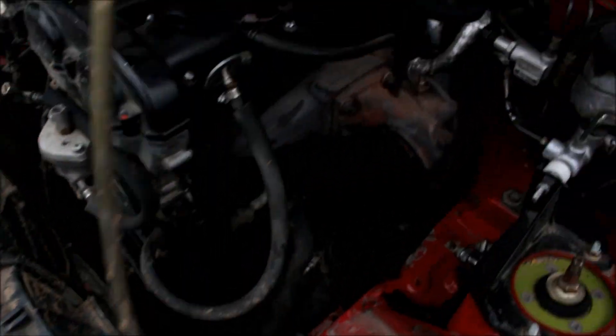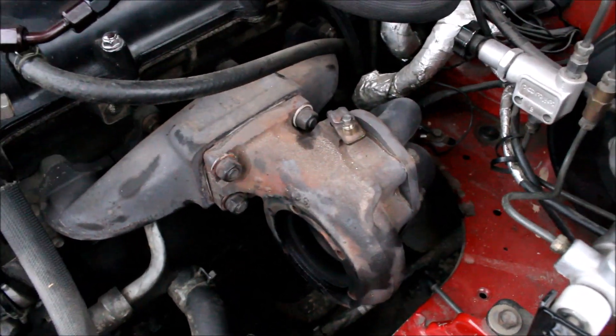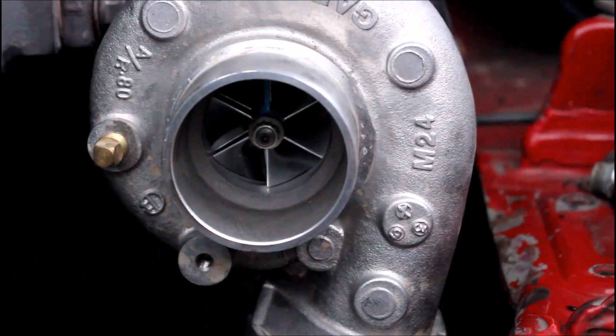Now I'm going to put all this back together. If you're worried about water lines and oil lines on your build, I'm going to cover it very in-depth on Broken Boosted when I get that far. Ready to slay some Mustangs. I'm now out testing the new compressor wheel. First thing I notice is this wheel is louder for sure - if you have a very open intake, you're going to notice the wheel is louder and has a different tone to it, which is cool. I know the sound doesn't affect performance, but it sounds cool. I haven't driven this car in a week - I've been driving the Broken Boosted, which is completely stock 1.6, so of course this car feels extremely fast right now. It seems to spool up faster, but as I explained, the butt dyno is very inaccurate, so I'm out here data logging to get hard evidence that this is actually a performance upgrade.